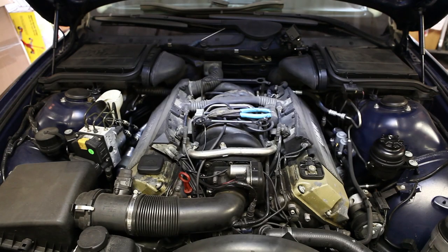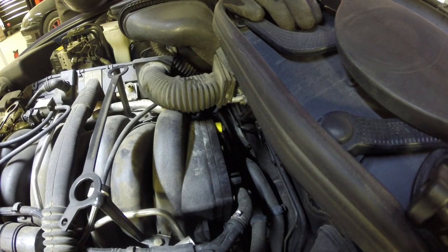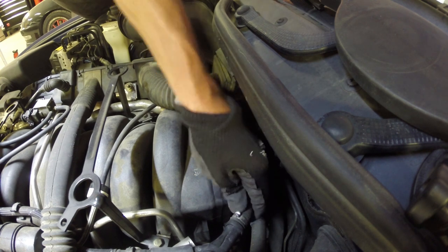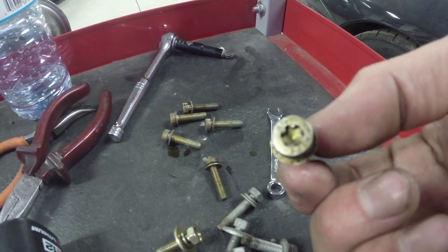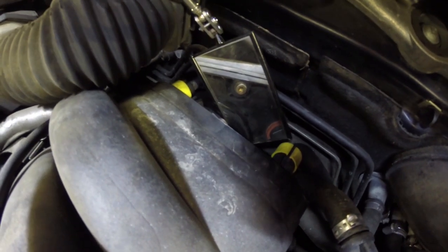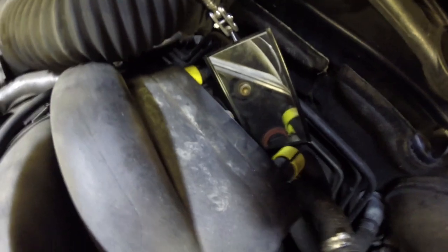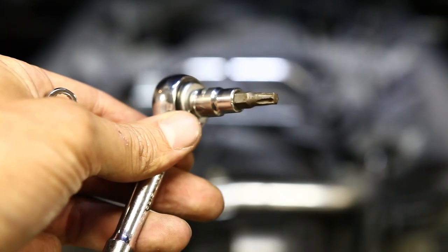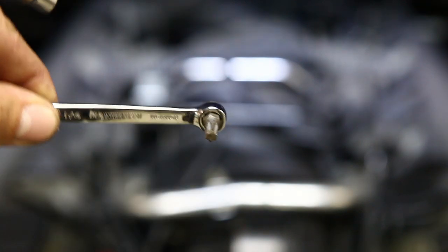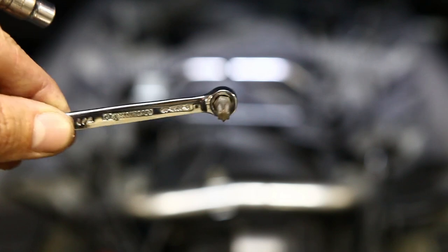The shop manual says you have to remove the intake manifold to gain access to and replace the valve, but that's a whole other headache in itself. So I've decided to remove the valve with the manifold on. The trickiest part of this job would be removing the Torx bolts because they're tucked away and hard to access. However, with the right tools, this job is manageable. You'll need a Torx bit and a quarter-inch hand ratchet, plus a quarter-inch wrench with the bit on the closed end for the really tight-to-reach bolts.